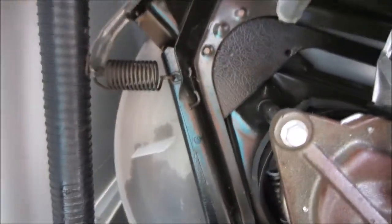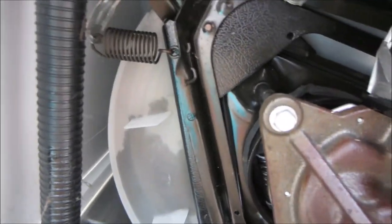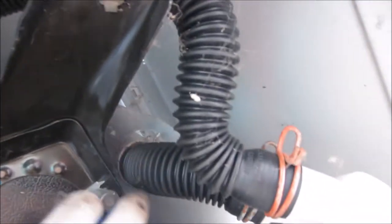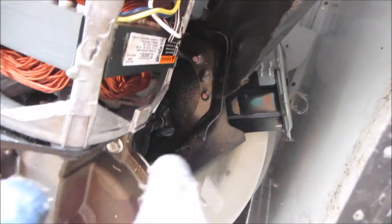Normally it happens on this side — typically if you move these machines around they bounce up against this and put pressure on it and crack these. You can also check your hoses — this hose here notoriously can spring leaks. I've actually never seen a main seal leak on this direct drive model, so that's normally not a problem.